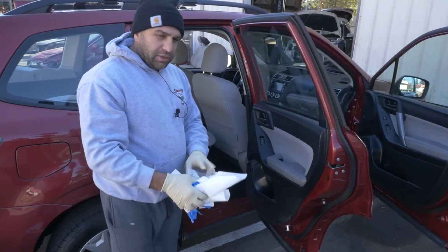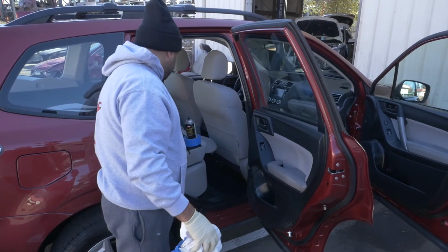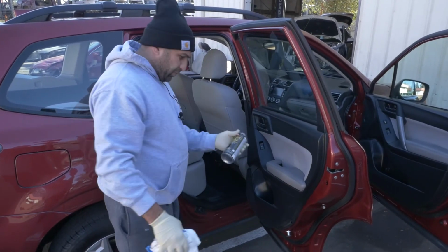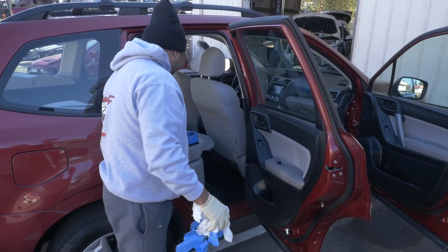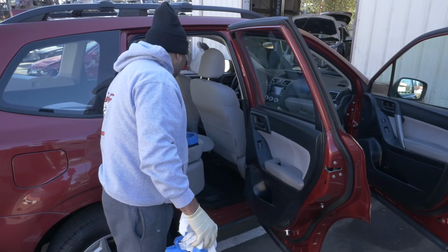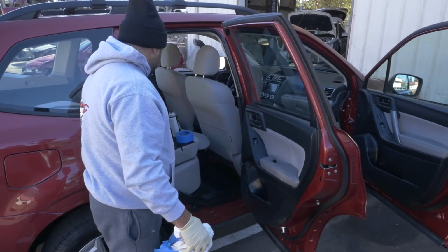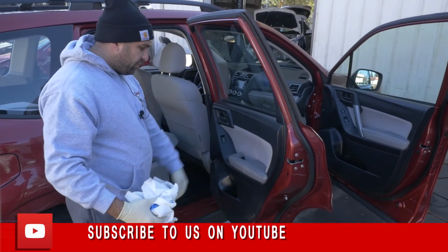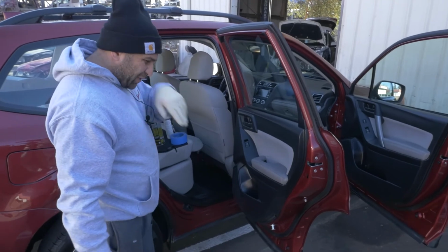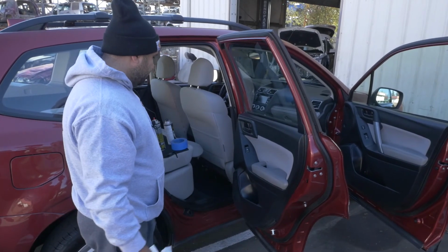Nothing special needed. You can get O'Reilly's, AutoZone brake cleaner. Any paint store will make you color to match, almost identical. Some tape, ghetto, but it works and is very stable, it's not gonna come off. Get the surface clean, that's what the brake cleaner's for, and a little scuffing helps it stick.